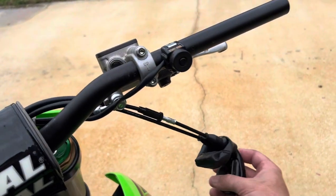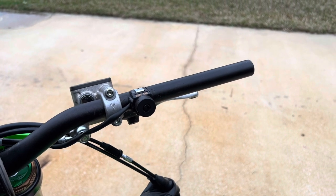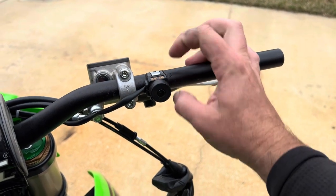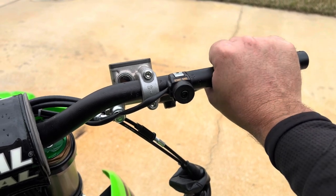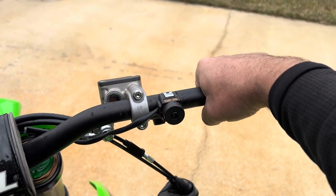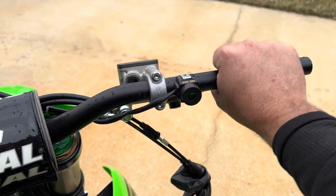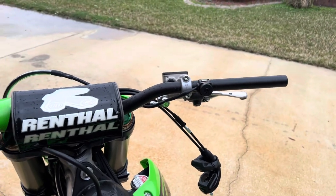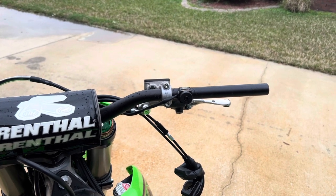The sensitivity of the throttle is way too much. There's a company called G2 that makes what's called a Throttle Tamer — it's a throttle body where the cam on it is oblong, so for the first half of the throttle turn it doesn't pull as much cable, meaning it's less sensitive. For the first 10 degrees or whatever, it's pulling less cable than a stock throttle. You can just buy one of those; they're not too expensive and it's a billet aluminum piece, so it's a little bit of an upgrade too.